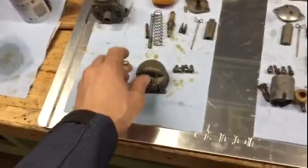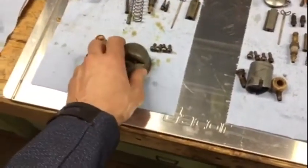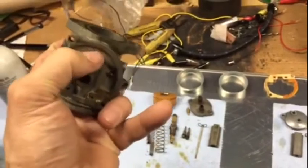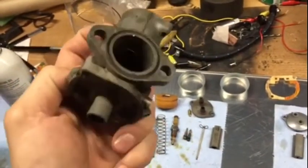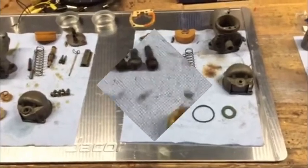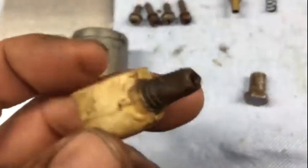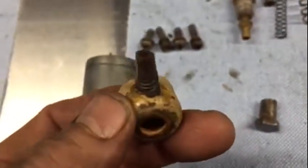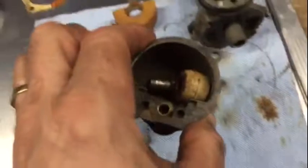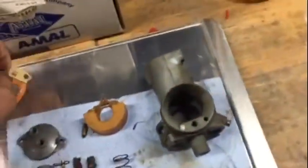I think this one's going to be the easiest to start with first - clean the float bowl, start cleaning it all out, make sure all the holes are clean because they were really corroded and gummed up. I hope I don't have to take that welch plug out to clean those jet orifices. Here's the banjo bolt that broke off in that bad float bowl, and then I got looking at it - somebody's jammed a piece of brass in there to make this little intake cup. That's garbage - not using any of that stuff, not using that gasket.